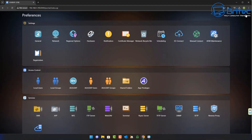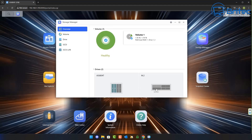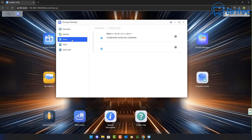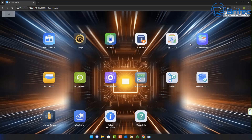Here's the ADM desktop. There's quite a lot here — a settings panel covering general network, regional options, hardware, notifications, and so on. This is where you set up local users, local groups, and shared folders. I can see a picture of the drives we've populated — only two for this tutorial. It shows our RAID setup, volumes, and drives, and will report drive health once synchronization is complete.